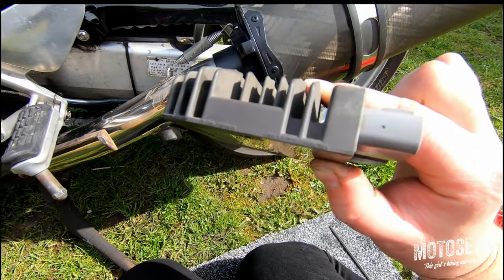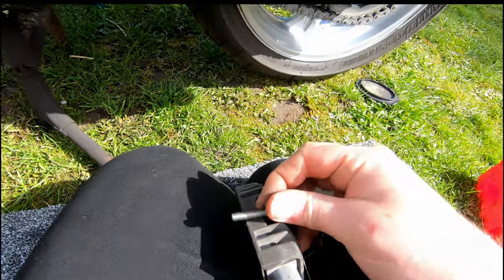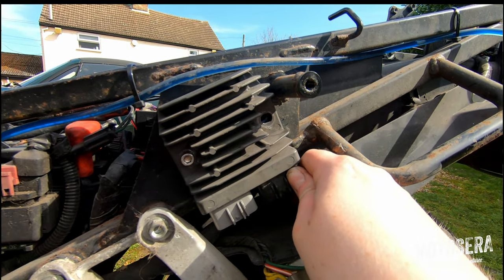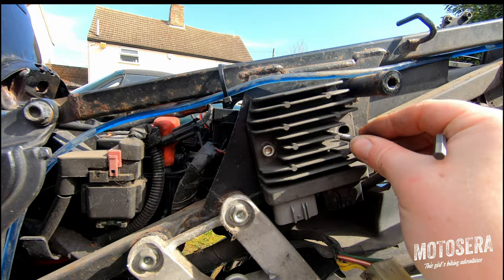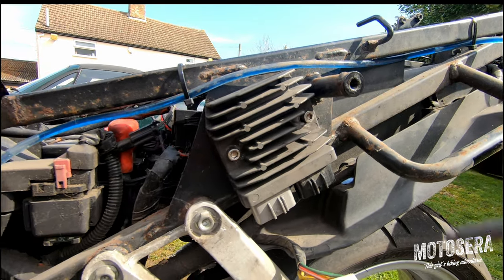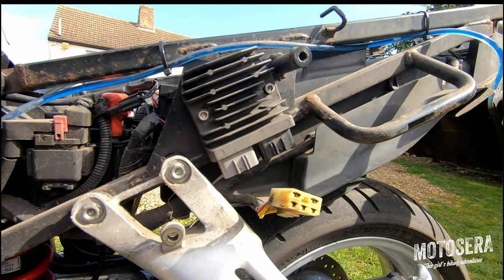With the new Regulator Rectifier it's a little bit thicker where it bolts onto the frame, so the original bolts are too short. I've found some slightly longer ones. If you use an FH020AA or FH012AA Regulator Rectifier, the original bolt holes in the frame will line up with the holes in the new Regulator Rectifier. That means you don't need to make any adapters or anything like that — it will bolt straight on in the original position and the cables are even long enough to reach. So this really is a very simple upgrade for the Blackbird, apart from refitting a new connector to the electrical side of things.